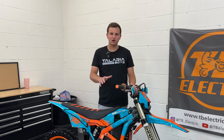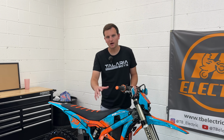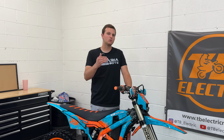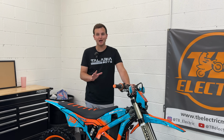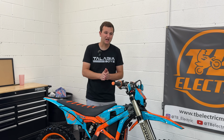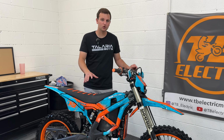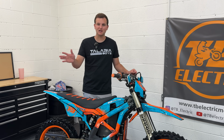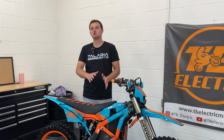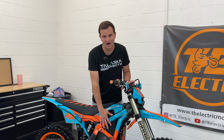Continuing on with talking about the power and performance of this Ultra Bee with the X9000 controller, the upgraded battery, and the upgraded motor, we started with just a controller, and we ran that for about 2 months. We did a lot of miles on it. And the one thing I have to say, I don't know if it's worth doing an upgraded controller on the stock battery and motor, at least in my opinion. We didn't get enough improvement in performance in my mind to justify the price of a controller unless you do plan to upgrade your battery.